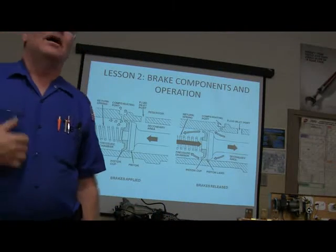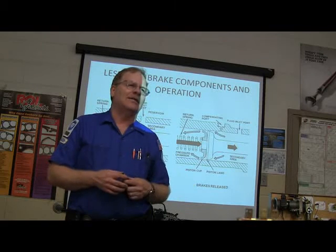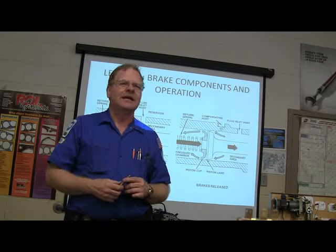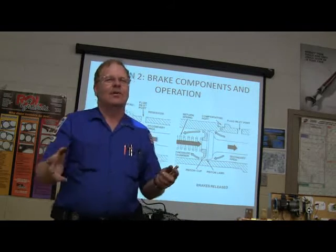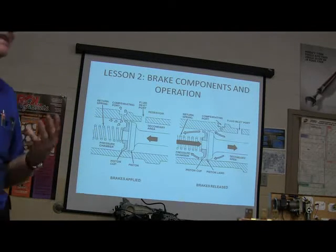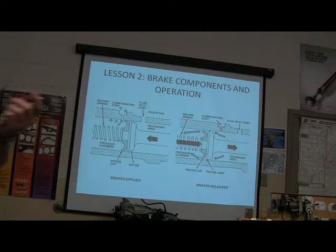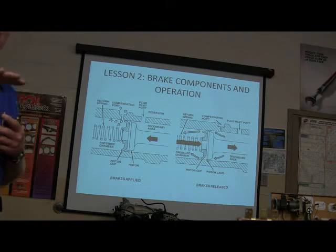You got it? Now, this one guy came in here with a Dodge pickup, a full-size Dodge pickup. And he said, I'm always having to add fluid to my master cylinder, but I haven't seen any leaks anywhere. And we looked at all four of the brakes, the calipers and everything, and they weren't leaking, and neither were the rear wheel cylinders, but he kept having to add brake fluid. And it turned out it was going into the brake booster. It was going out the back of the master cylinder, and when we pulled the brake booster off of that truck, we poured about a quart and a half of fluid out of it. Wow. And we had to put a master cylinder on. We couldn't see that and didn't know it until the inside of the booster got so full of fluid that the booster wouldn't work anymore. And there was nothing wet, you couldn't see anything wet anywhere. But when you pull the master cylinder off of that booster and shine a light in there, you'd see the brake fluid puddled up in there. Wow.